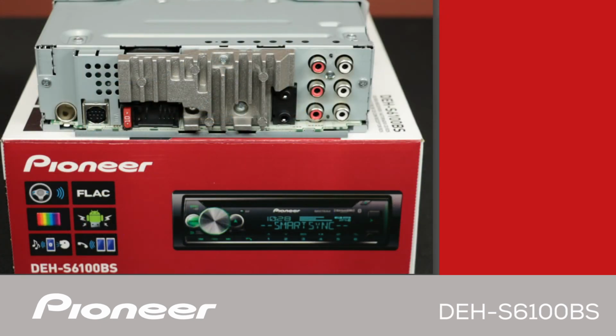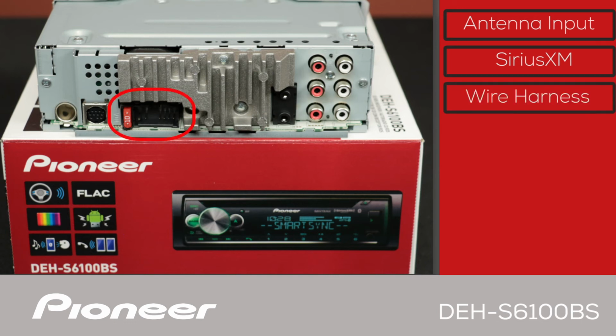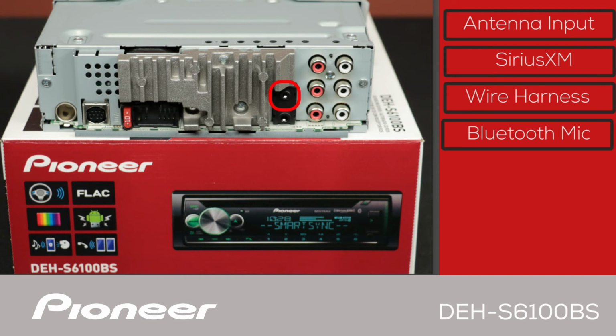On the back panel of the DEH-S6100BS, the AM/FM antenna from the vehicle will plug in right here. The optional SXV300 tuner from SiriusXM will plug in right here. The wire harness connected to the vehicle will plug in right here. The black jack on the top here is to plug in the Bluetooth microphone included with the in-dash receiver. And the one on the bottom is for operating your steering wheel controls through a third-party adapter.